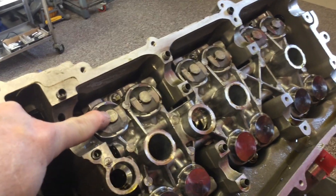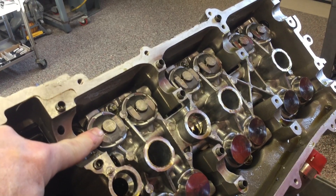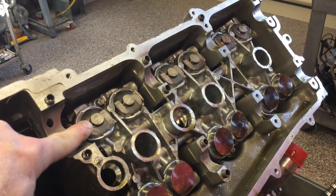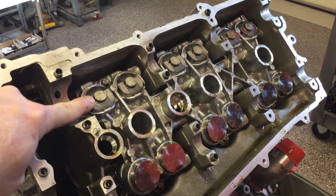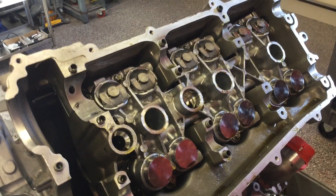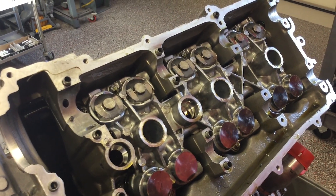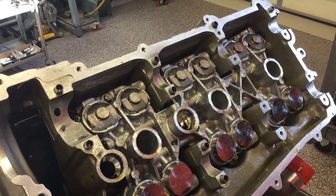What we've got here is a scenario where collateral damage has crashed open valves into pistons, because when the intermediate shaft ended up coming apart the way that it did, it compromised the camshaft timing, and all the valve timing events followed that. So all the intake VarioCam lifters on this side of the engine are compromised and will have to be thrown away. We'll look for more collateral damage next.